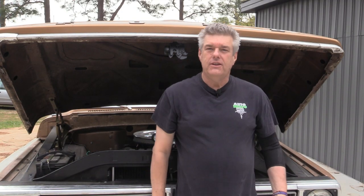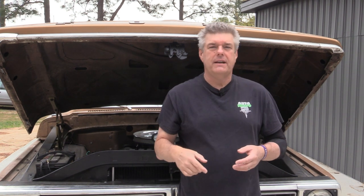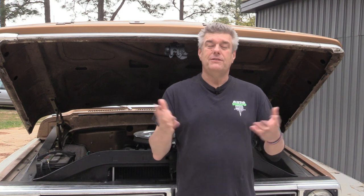So now we're going to talk about head gasket issues. A cold head gasket leak is hard to detect. But if it's a hot head gasket leak, you're going to get steam or condensate out of the exhaust pipes even if the car is warm. If the car is warm and running and you're getting a lot of steam out of the exhaust, you probably have a head gasket leak — and that's going to require pulling the cylinder heads off. Some guys say you can put this blue stuff down inside there, but if you've got enough steam coming out of the pipes when the engine is warm, you have a real problem. That can also be detected through the radiator — you can get a tester to let you know if the head gasket has popped and you're getting exhaust gases inside the coolant or inside your radiator.